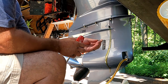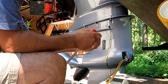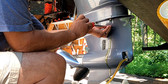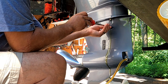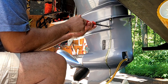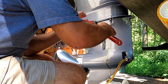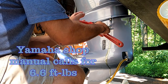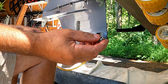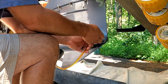I'm going to take my upper plug — it's got a new gasket on it, it's the one without the magnet. Usually not a fan of starting a fastener with a tool, but it's kind of hard to reach. Just be careful not to cross-thread it. I'm not putting a lot of torque on this — it's just easier if I put pressure on the back of the screwdriver and use the wrench. Make sure you have your lower plug ready. This isn't going to rush out of here because we've put the upper plug back on.